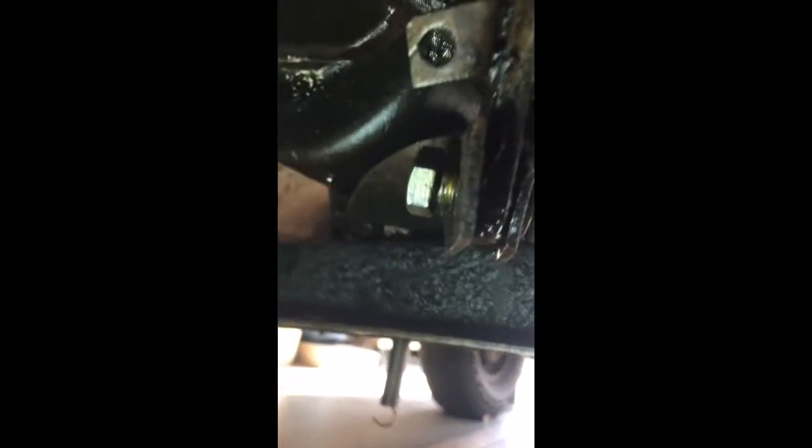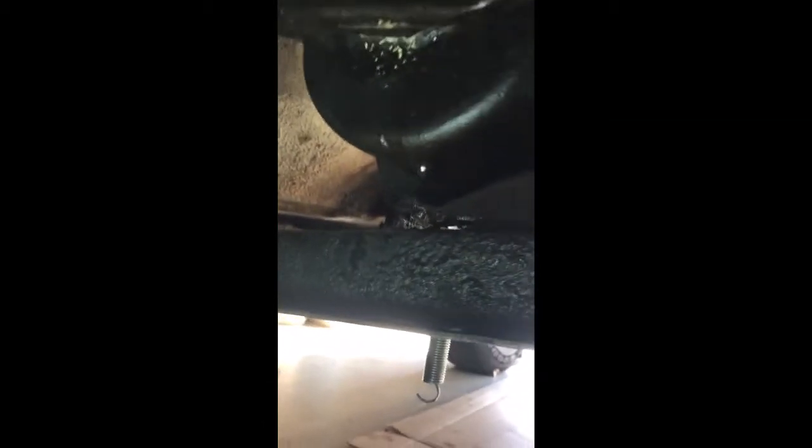and as a result, since this is still attached to the bell housing, the cylinder and the bracket are attached to the transmission case, there's no way I'm going to be able to pull it off. So just realize that. I just want to bring it to everybody's attention that you might have a similar setup, and I'm just going to have to undo the nut and bolt right here, which I already started, and then hopefully it should slide right off. And the main thing I'm definitely going to have to make a mental note of is to put that bracket back on before I install the transmission, because I definitely don't want to have to do it more than once.